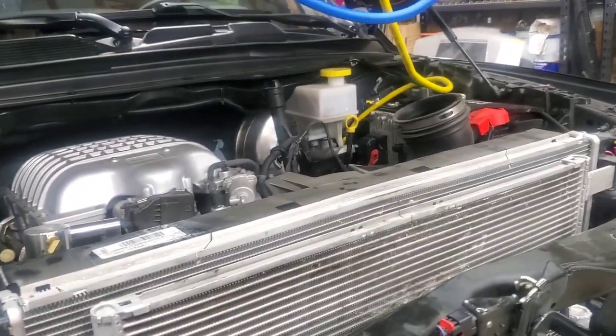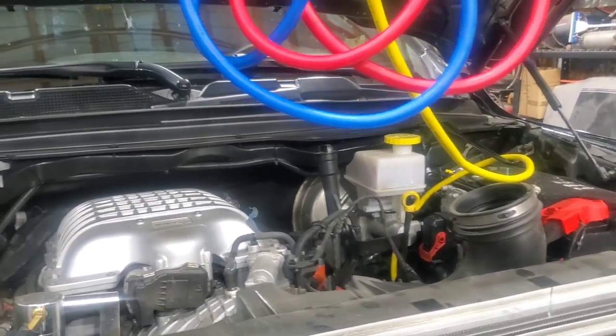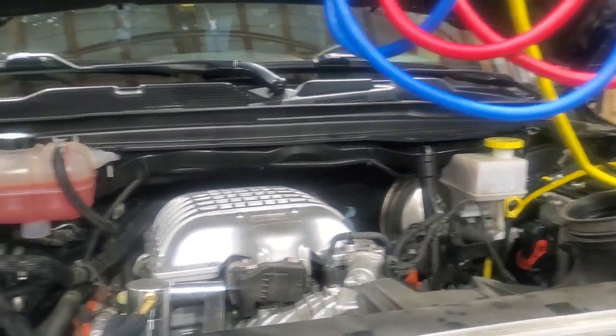Originally, the hose connected to the top of the tank was going to the top line on the intercooler and then to the water pump. That top hose is now used for this connector. Down here off the pump there's a short hose, and you use the connector from the upper hose with that splice connection. You remove it from the upper hose, use the clamps, and go to the inside of the inner chiller, then come out of the chiller into the reservoir tank.